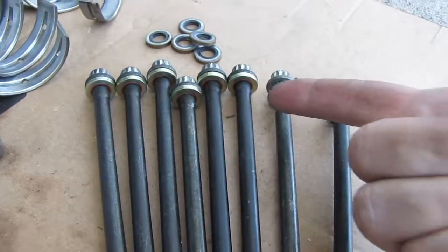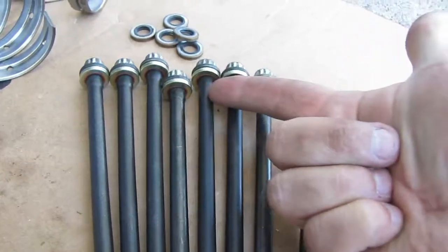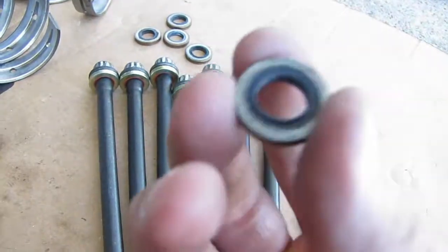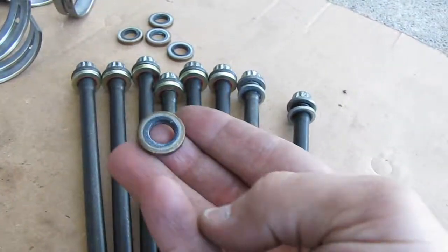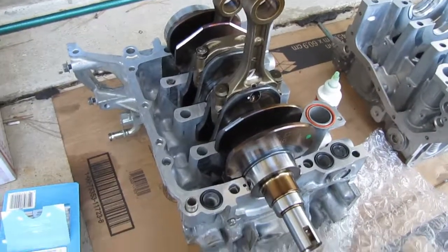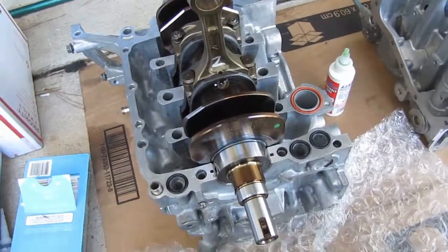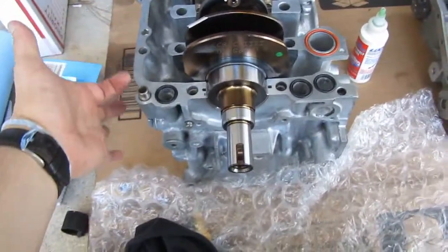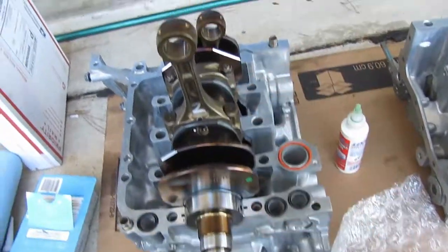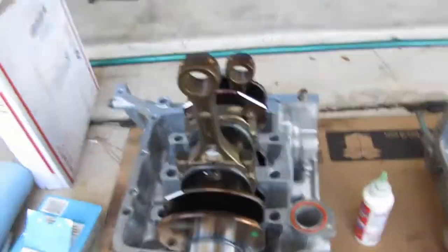You want to use brand new seals. These keep water from the water jackets from coming through, so you want to make sure you use new seals — you don't want to use an old scaly one. The crankshaft is in block one and three, and now we're gonna RTV all around and then put block two and four right on top and bolt it down.